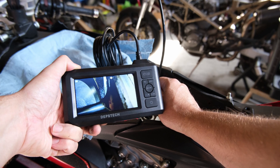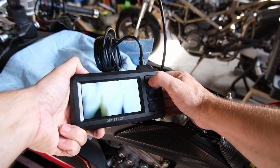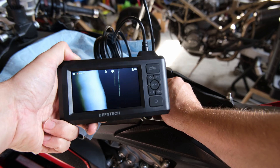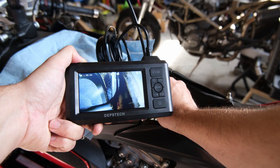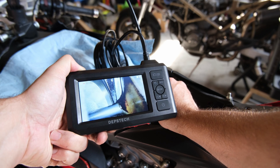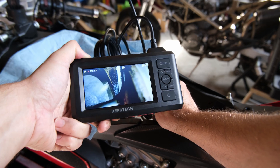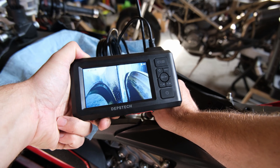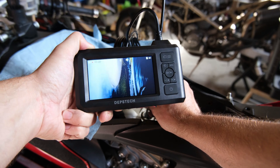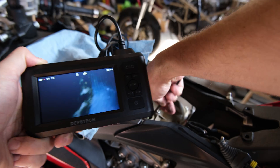Look at that — let me start recording. That's very impressive. Look at that valve stem and valve stem seal — all looks very clean on the intake. You can even see the wear on the valve seat. So there's your exhaust, shut. Let me rotate this and see if I can see the other intake valve — there's one.